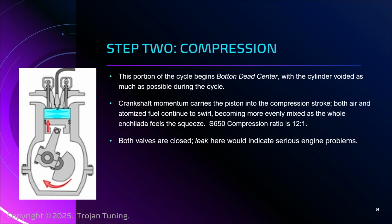And maybe like 11.8, 11.9:1. Not good, but engineering is the study of the imperfect, and just keeping it running. But if you say, hey, you're supposed to be 12:1, you're only holding 8:1, you've got a leak, you've got a problem, there's something wrong. Something about your crankcase overall, it's a problem, a big one. Just to highlight here that air is not leaking, coming or going at this point. We're just squeezing the shit out of it.